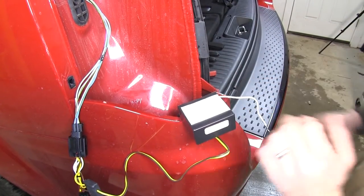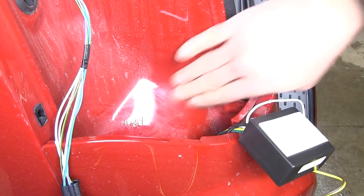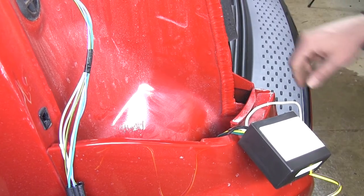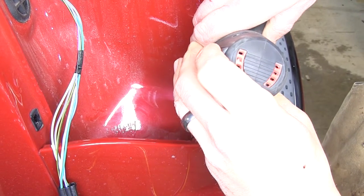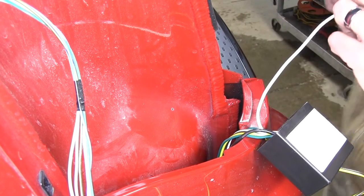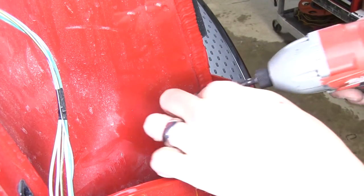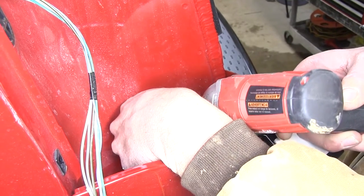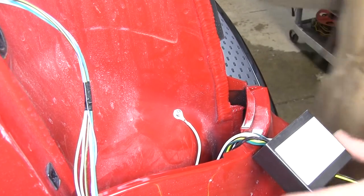For the ground we're going to need a drill with a three thirty-seconds bit. We're going to find a suitable mounting location inside our rear tail light housing area — you don't want it too high to interfere with the tail light when it goes in. Before drilling, verify that you don't have any wires hanging out behind there. We'll take our provided self-tapping screw, place it through our wire, and screw it into the hole we've drilled. That's going to ground our module out to our body.